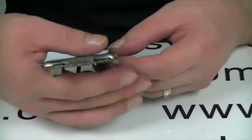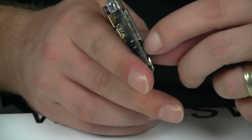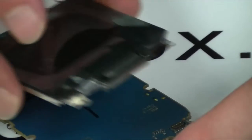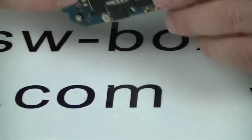From here on in it's really easy. You just unplug this plug at the top here — just use your fingernails again, pop it off, and the screen should come off. Obviously some of them are stuck down. On the new one you'll find a sticker pad here that you have to peel off — that will stick it down to the motherboard, but to be honest you don't really need to do it, because it will hold into place by the screws. So you just lay it back down into place like so.